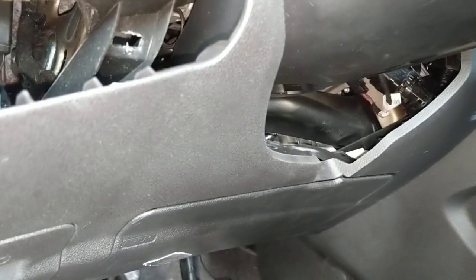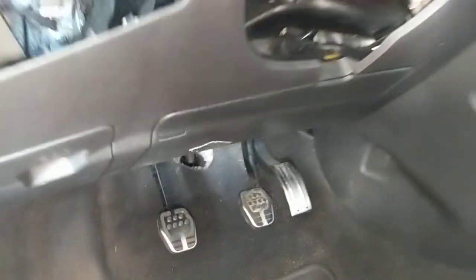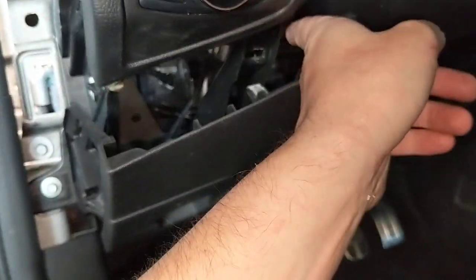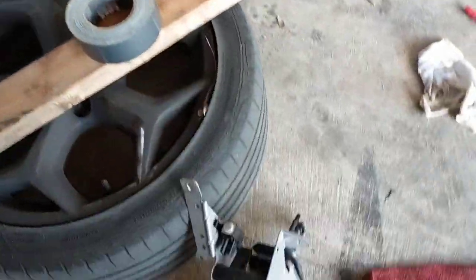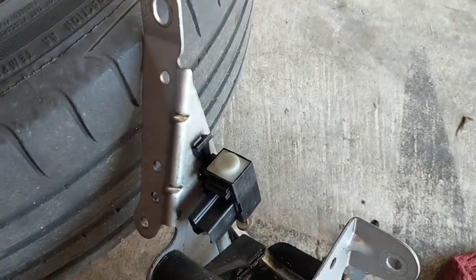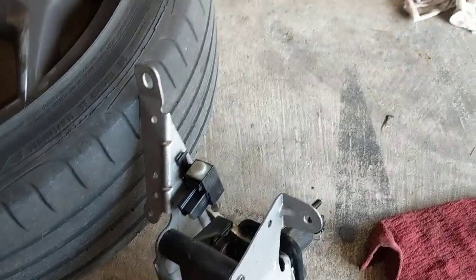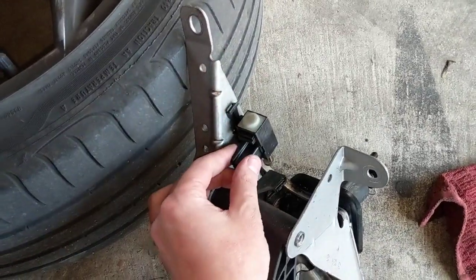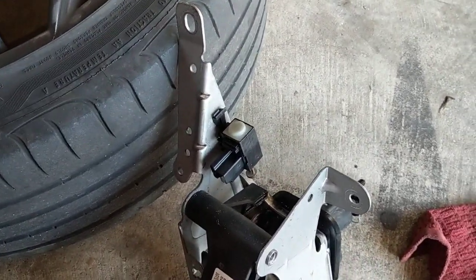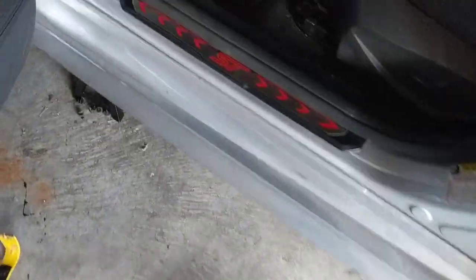If you can pull the whole dash panel off it might be easier, because that switch is way up there in elevation and you can't get to it — it's on the inside of a loop. With the clutch pedal released, not depressed, you have more room, but there's a tab that comes up and squeezes the clip, so you can't actually get it in. Total nightmare.